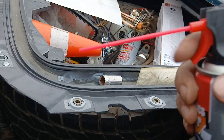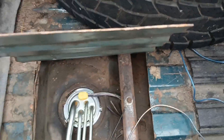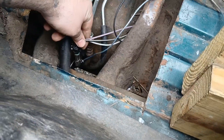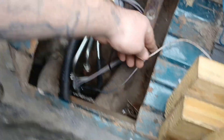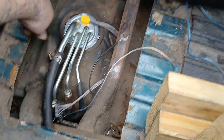It is all done. I took some electronics duster and sprayed around the fuel pump hole before installing the fuel pump and got a lot of debris out of there. I was actually able to get the fuel pump seated this time — usually it was just sitting there loose, but now I got it sitting in there pretty tight. Got the ground hooked up, got this hooked up. I took a speaker wire and wrapped it around this connection down here and tied it, so after I disconnect this the wire won't fall out — I can just pull the speaker wire. This hose doesn't have a clamp on it and I don't think it ever did.